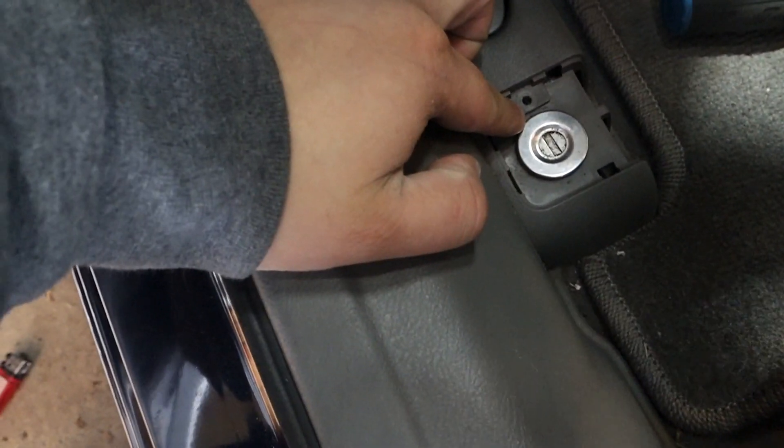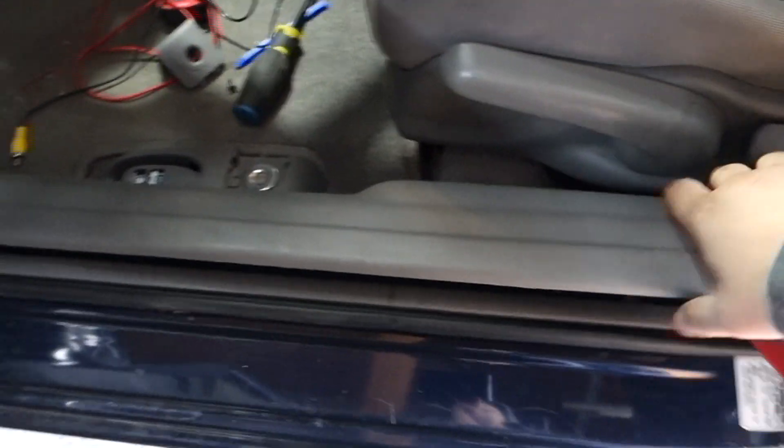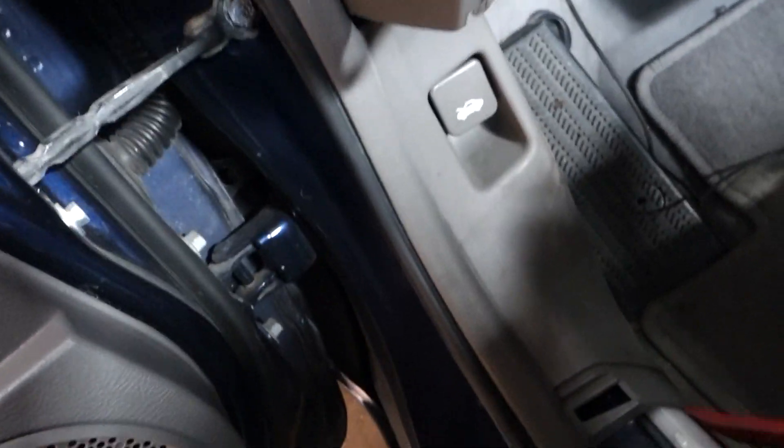To access it you're gonna need to pop this cover off — it has a screw. Work it from underneath, there's a little tab — stick something in, pop it off, take that screw out. Then you can start lifting. You might need a pry tool to get you started. Once you lift up here, there are pins here and here — push back then up and out. Be careful because you will lose some of these retaining clips, so make sure you keep them.